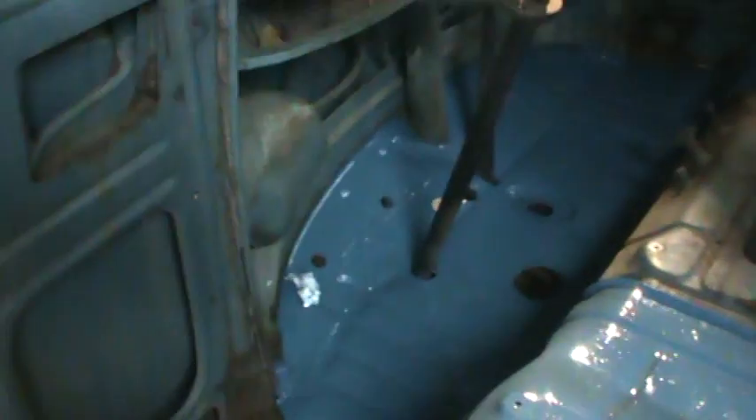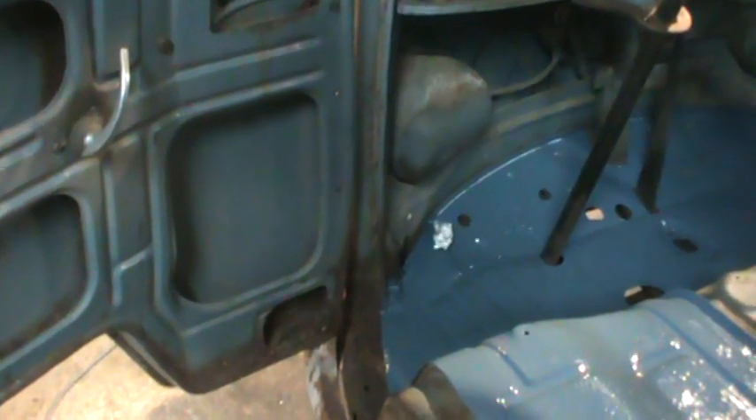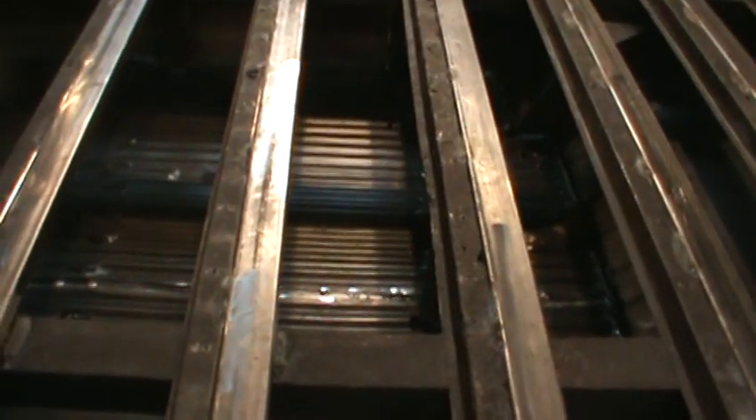I think I'm going to do that on the rest of the body too. On the inside it's a little different in here - welded in the floors and then sealed all the welds, and then again the same on the top. Then mixed up some paint to see how close I can kind of come to what the other stuff was. I know it's too shiny and it's still too blue. I have gray, blue, and black to work with, so I'll add a little more gray, less black, less blue on the next batch. Because I want to still do the inside of here, and all the decking has been removed from the top of this because I'm gonna go play down below. I got some more parts in - got a gas tank came in.